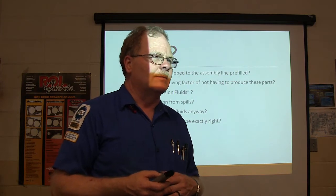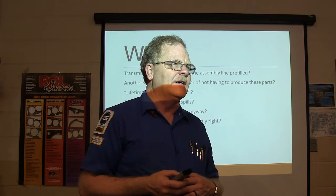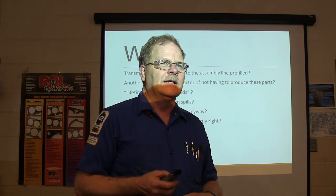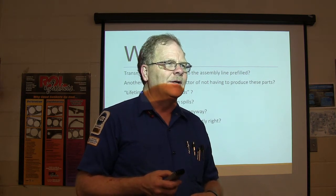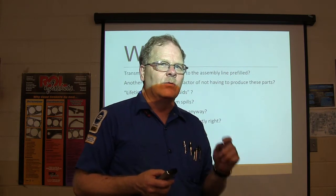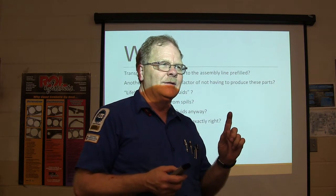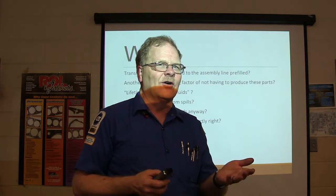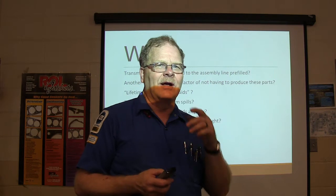So I called Jimmy and said, what did you find wrong with that transmission that Adam had over? He said, they put the wrong fluid in it when they built it. And I said, how do you know? He said, I can smell it. If you know the friction modifier, you can smell it in that fluid. It had the wrong fluid in it. The fact that Jimmy was quick enough to pick up on that by just smelling the fluid, that's not the right fluid, it's not going to work right. He said a fluid exchange took care of the problem.